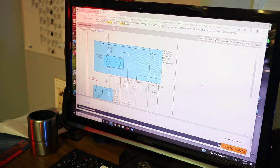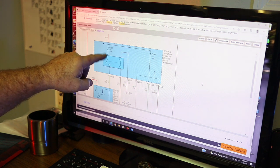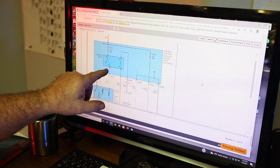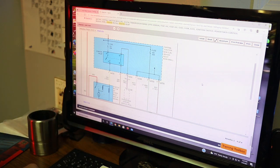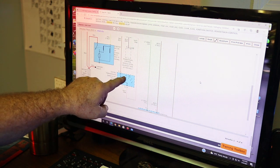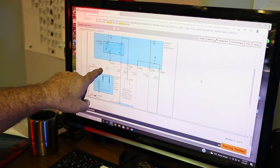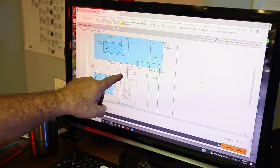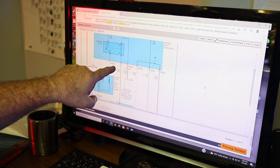The way I diagnosed this Ford Expedition: my fuse was good because I checked right at the relay leg in the central junction box. I had my 12 volts at circuit 30 in the relay — from fuse 101 in the junction box right next to it — but the output was never getting anything. So if I jumped the relay myself, I got power out and the starter cranked and the truck would start. I know I have power coming in, but my prindle switch on the transmission could interrupt that power. Wire colors like tan and red, blue and orange, white and pink — those are wire color abbreviations shown in the wiring diagram.